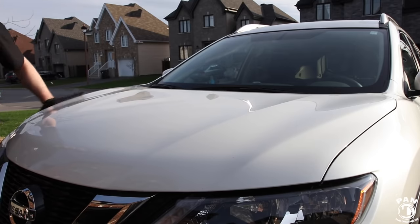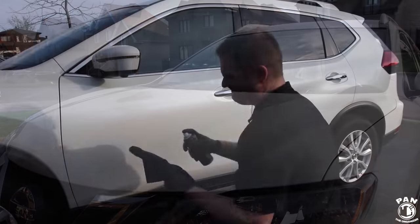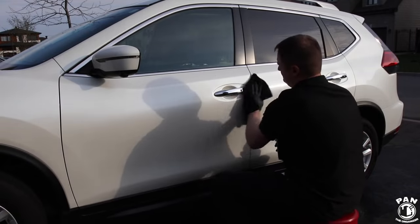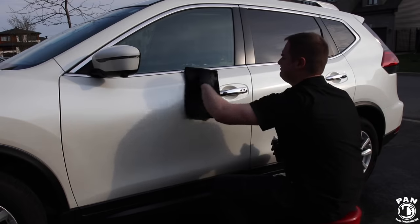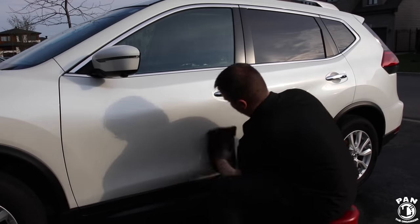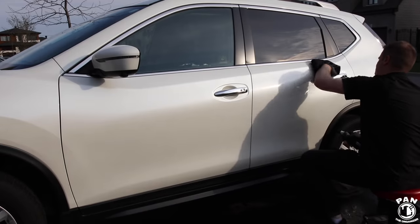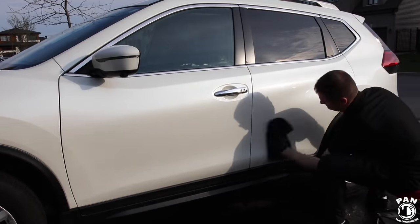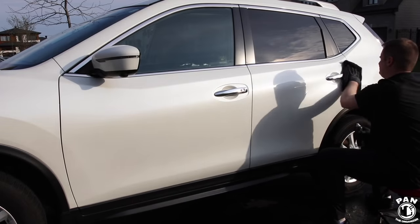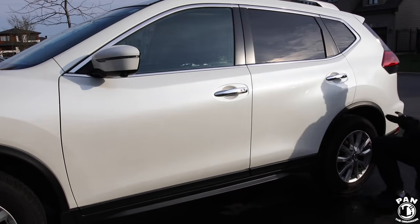The car is going to be easier to wash as well. The traditional forms of paint protection are carnauba waxes, paint sealants, and ceramic coatings — I have many tutorials on my channel showing how to apply each one of those. In this case we went with a very easy-to-apply, economical paint protection — you can do five to six vehicles with one can, so a little goes a long way. Make sure you work in a shaded area, but you can also use this in direct sunlight, which is good for mobile detailers.